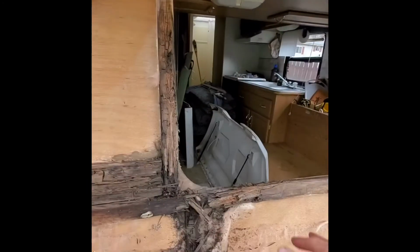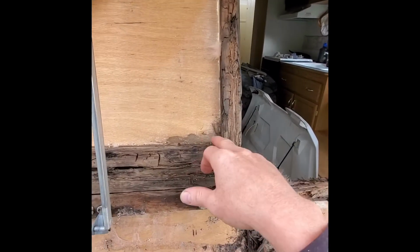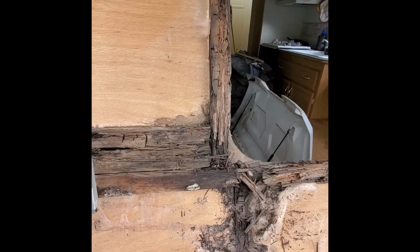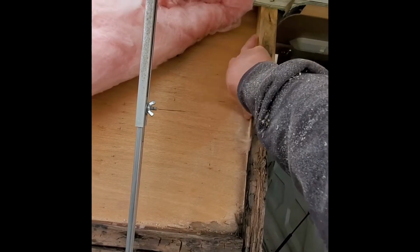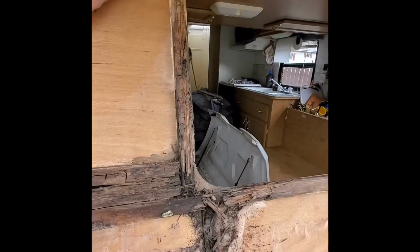Then I'll get everything in, and then I'll see how solid it is. If you need to put some L brackets, some 90 metal L brackets, in some places, do that. If you need to scab another board on the side of this splice, that probably is not a bad idea. Get some good screws going this way in it.